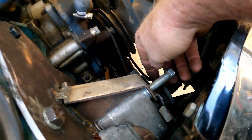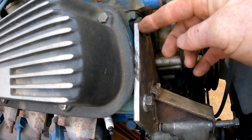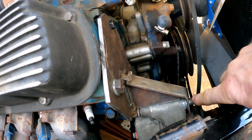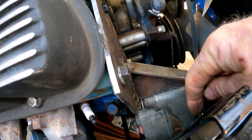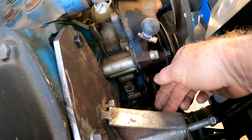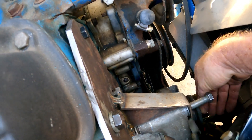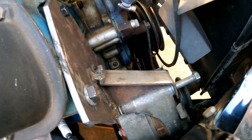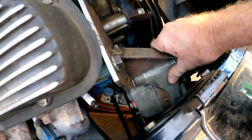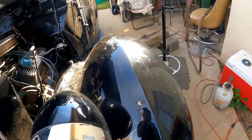The power steering will run off the water pump pulley and the crank over there, and then the alternator will run off the crank pulley only over to here. So I came up with this piece of 3/16 steel — it's kind of rough shaped right now — and I got my hanger here. I left it so I can shim it and move it a bit, then I'll run a plate from here to here and it'll be totally self-contained. I've already got my adjustment right here and it swings around the bottom. That turned out pretty nice — I'm pretty happy about it. That was something weighing on my mind, and it took about a day to come up with all this.